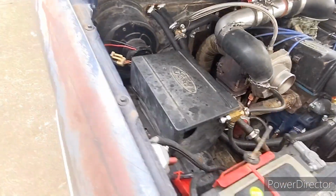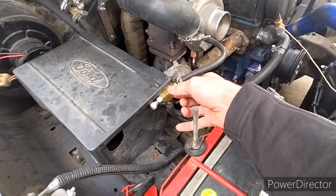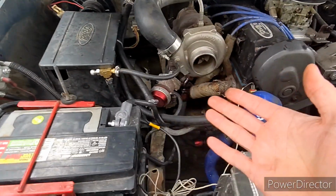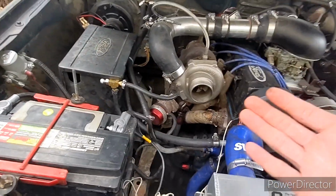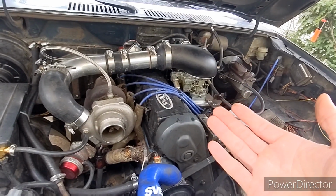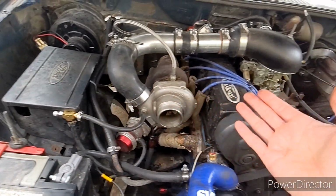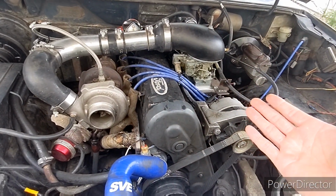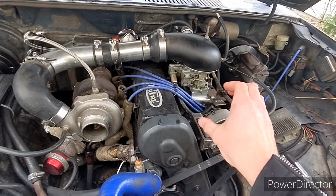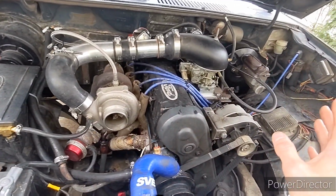Just an eBay wastegate, but I do have a very cheap but well-made manual boost controller. Currently running 9. When I got to 10 pounds, I noticed that I had boost creep at 4,000 RPM. I'm running a Holley blue pump, and the blue pump is only good to 14 pounds. So once I hit a little bit of boost creep at 4,000 RPM, I started getting fuel cut where my fuel pressure was being overcome by the boost. So I knocked the boost back 1 pound. That's all I did. Now I can run up to a full 5,500.